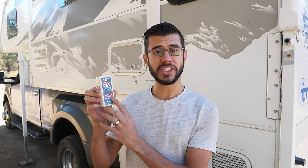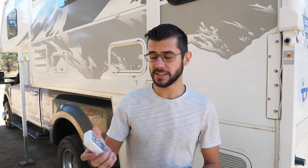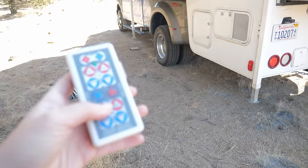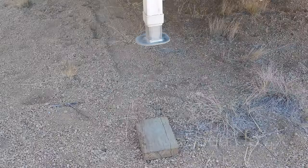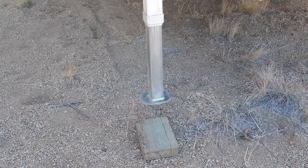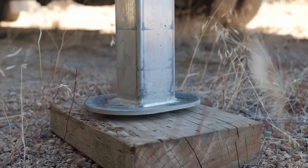Now comes the point where we actually lift the camper off the truck. This camper utilizes a wireless remote control that can individually control each jack or control them all at the same time. We're going to start by pressing the all-up button, which lifts the camper by lowering the jacks, and we're going to watch each individual jack to make sure they all touch the ground at the same time. When the first jack touches, stop and individually ensure all are on the ground before lifting them all evenly. On electric models the jacks might lower at slightly different rates, so it's critical to stop occasionally and adjust individual jacks to maintain even pressure.